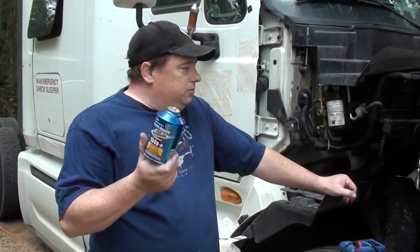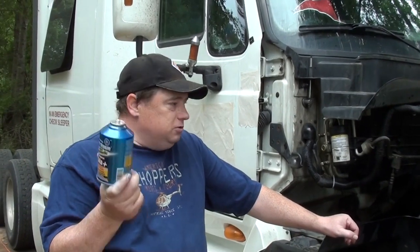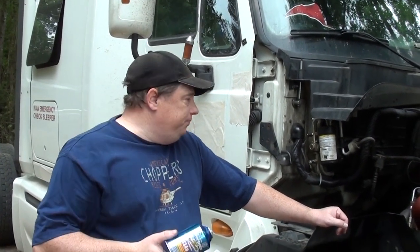Once it kicks in on its own, if that got you going, then you know roughly you have about 12 ounces in the system. Maybe there's 14 or 16, okay? You knew, first of all, that a little bit of refrigerant made it come back on and run, and second of all, that it's low, and it's only got about a can, less than two cans in it. So this system on the Prostar,